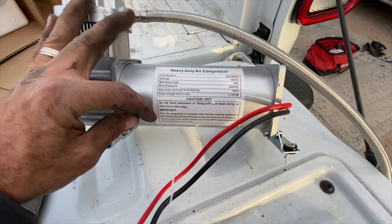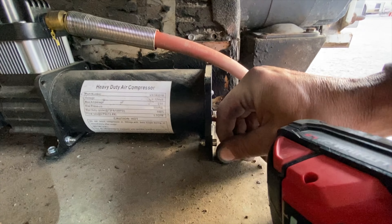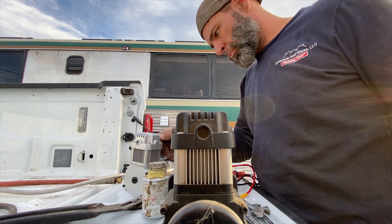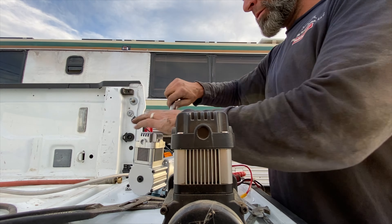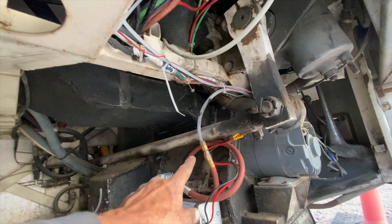My main fix for today was the brake line. I also got my compressor in. My front bow door actually has an auxiliary air compressor that fills up a tank, and off of that I have a remote entry that actuates the air valve for the bow door. The Surican is what airs up my auxiliary air tank — it's a max 200 psi, 100% continuous duty air compressor, 12 volt. The only thing I have to do is dismount it, put the new one in, and transfer the swivel line and check valve from the old unit onto the new unit — it's a pretty easy swap. I just need to do some cable management with zip ties and I've got the check valve back in there.